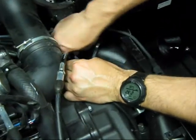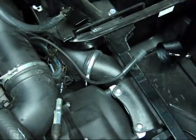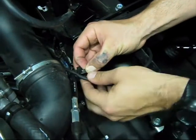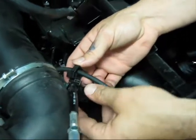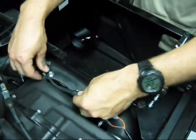The original wire was held onto the emergency brake cable. Take that off and pry it open. Pop that little clip open, stick the wire through there. The wire is positioned as so.